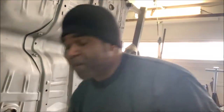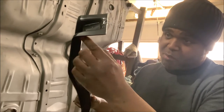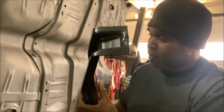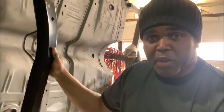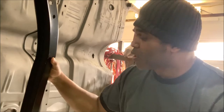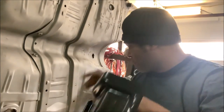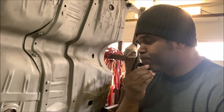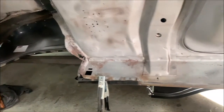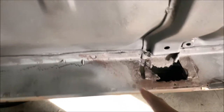But we're going to repair it. This is a new brace — you see how it comes down? This piece welds up against the inner rocker. This is what needs to be repaired as well, and we're going to attempt to fix this. But the first thing we got to do is we can't even think about this piece yet. The rear inner rocker is in really good shape up until you get to about this point.